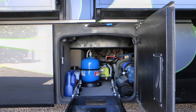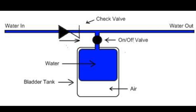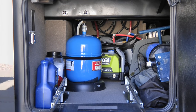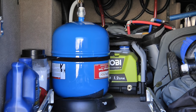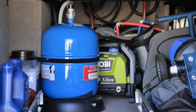Let's have a look and see what this improvement or upgrade is. As you can see there's a blue water tank, which is a pressure tank as used on central heating systems. Basically this is a two gallon tank, and it's plumbed in line with the outlet of the water pump. This will fill up with two gallons of water under pressure, which means through the night if you want to use the toilet, the pump — which is situated just below one side of the bed in one of the bay lockers — doesn't run because the water is being supplied from that pressure tank. The only time the pump will now run is to refill that tank.